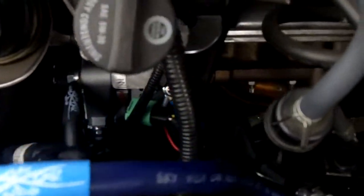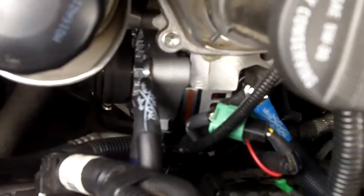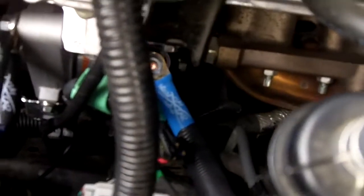I guess I'll show you — see if we can get a shot of it under the hood. It's buried way down in there. I got two 1/0 grounds, and then I got a 1/0 power cable. This is the little piggyback harness right here, this green one, and this little red wire goes onto the output post. The adjustment knob is right here — that little popper-looking thing? It's a potentiometer. It's really small, but you just need a little pocket screwdriver and you can adjust it.